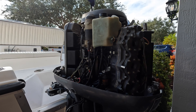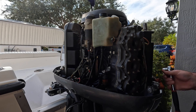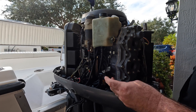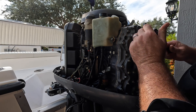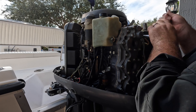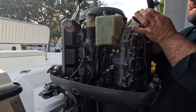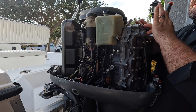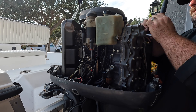I've got a quarter-inch drive here on a 12 millimeter and I'm going to start ripping apart this head. I'm going to leave the water jacket on for now - actually, I'll rip the water jacket off too. I'll start with that because I've got to rip it all apart anyway, might as well. I don't need to pull the thermostat - I'm just going to pull it all. This is the thermostat housing. I've seen holes in the back of these, but I'm going to pull it all apart just for good measure.